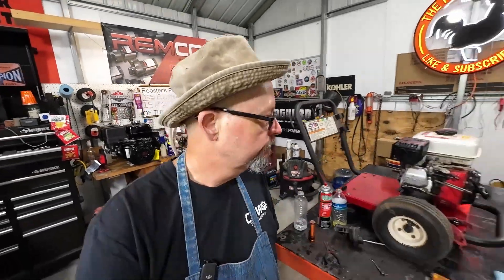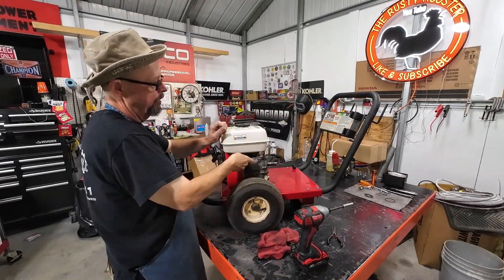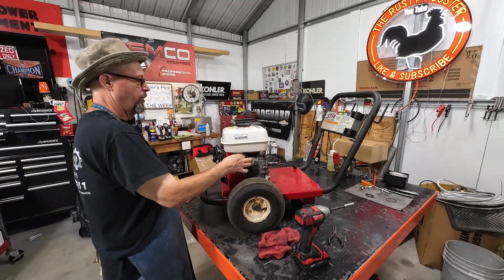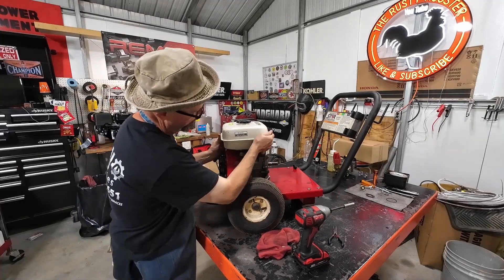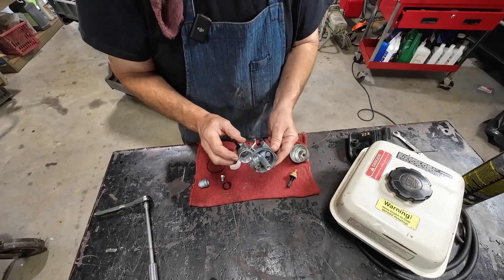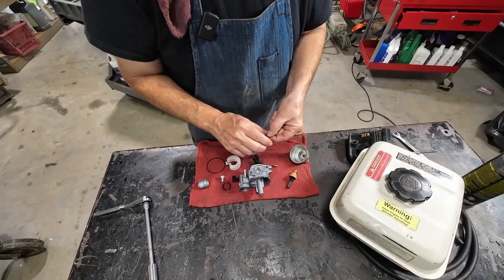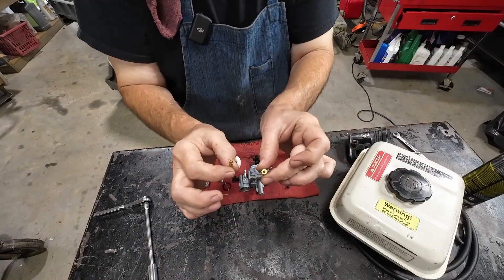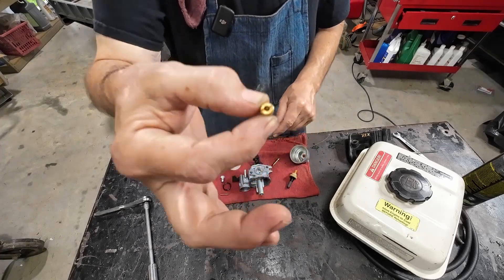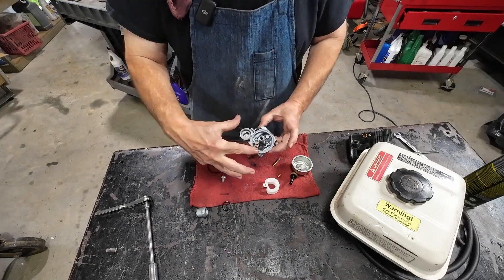While that's buzzing away in the ultrasonic cleaner, I'm going to go throw a fresh fuel line on that bottom of the gas tank. I got my tank off. Got my carburetor out of that ultrasonic solution — man, she wasn't bad going in, but it cleaned up nice and all my brass turned out really good. I could tell especially down in that jet. I'm so happy with how everything cleaned up. Let's get it put back together.